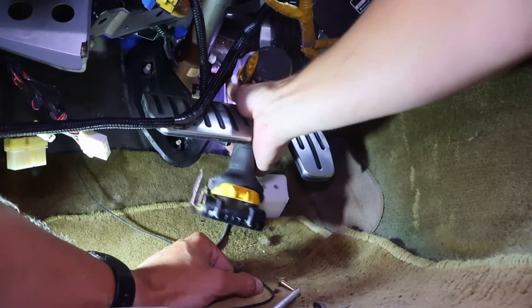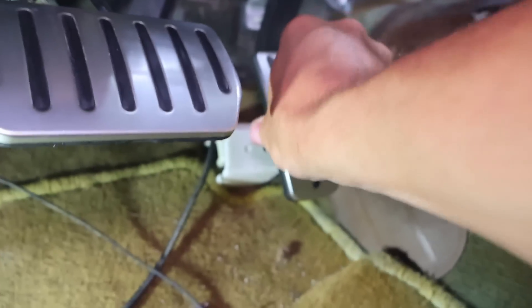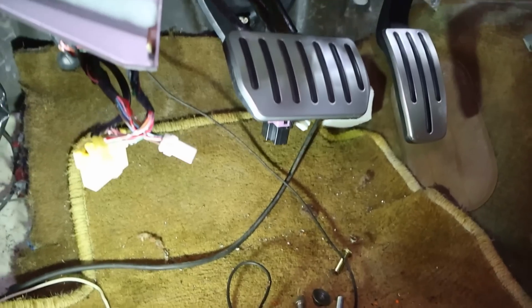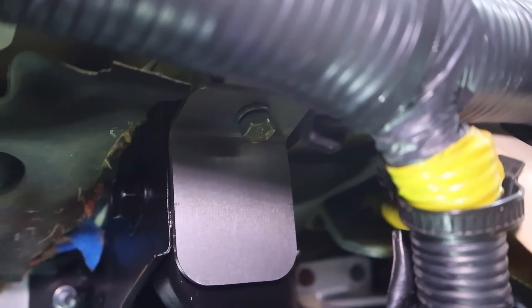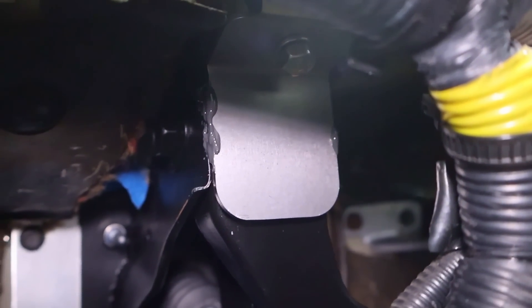The pedal is in place. I'm absolutely loving the position — we got just the right amount all around, and that feels so steady and firm. Now the brake pedal — we had one last piece we didn't quite get to. There was one bolt hole up there and we had to saw off a part. We got it back from SendCutSend, so I'm just going to epoxy this in place so we can weld it. Just put a little dab on either side, let that set up, and then weld it.